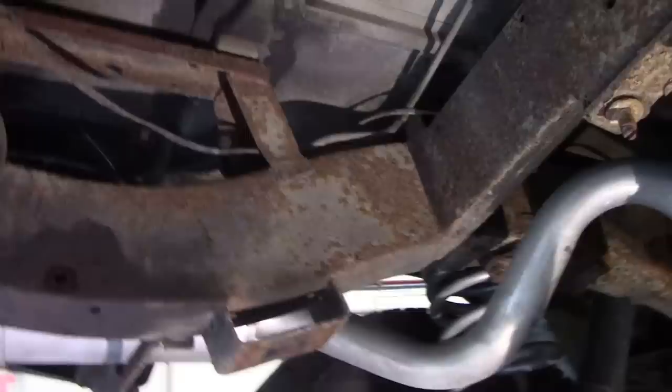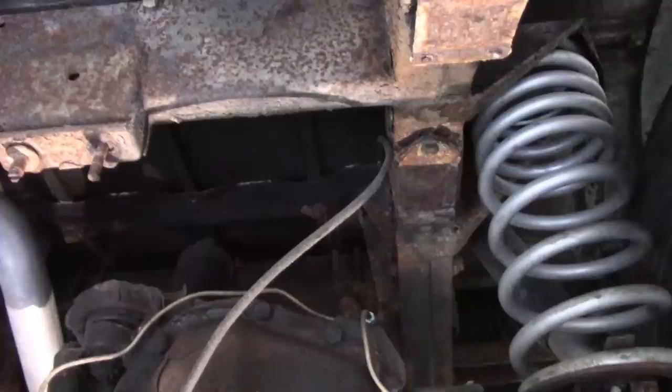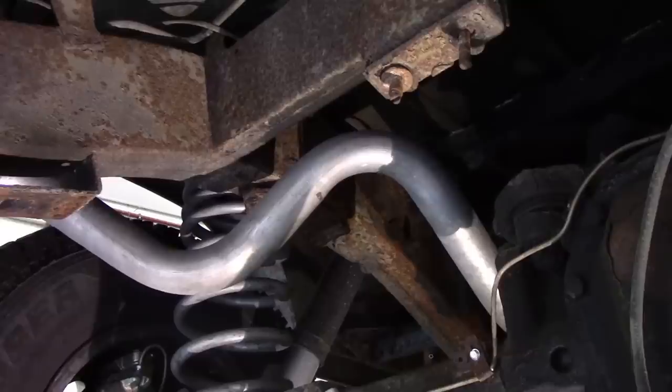I think we're going to have to invest heavily in some wax-based rust-proofing to stop further corrosion. You can sandblast the life out of a Land Rover chassis but you can't blast inside it. The only way to get all the rust out is to dip it in acid like they do before galvanizing — but be warned: the acid at the galvanizing plant will not take paint off. If there's existing paint still in the frame, the only way to remove that is in a caustic bath. So: caustic bath, galvanizing, sandblasting — it all adds up. You might as well buy a new frame.